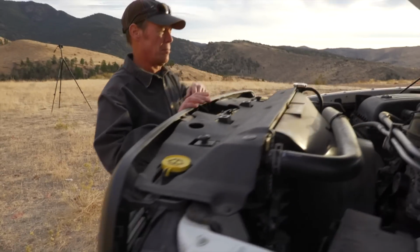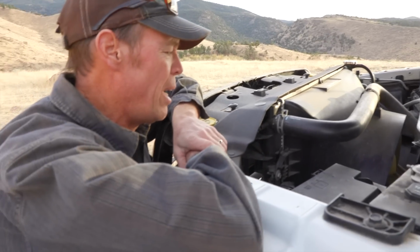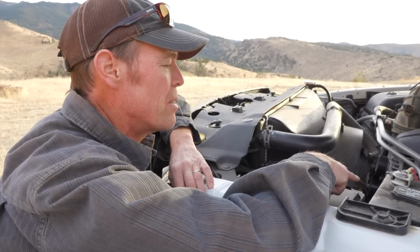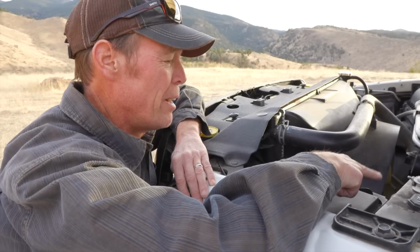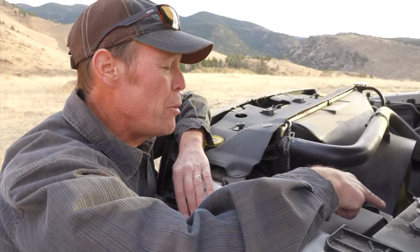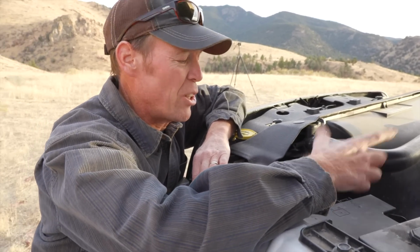So anything abnormal in here? No, I pretty much keep everything stock, except I did put some high energy coils on. I got these at one of the hot rod shops. They're called Sultans of Spark. So instead of 22,000 volts, they produce 40,000 volts. And I actually did notice a big difference with new Champion plugs at 45 thousandths gap. With these, I picked up 2 miles per gallon. So that's the only thing I've done to the engine.